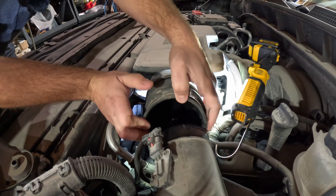You guys can see I made a little bit of a mess down there with the belt dressing, so we're going to clean that up with some Super Clean and get that belt off. You can see the belt is basically shot — there's fraying on it. The belt is not super dry or cracked, but it is kind of shiny and maybe a little harder. You can see the fraying along that edge — that's a good indication the belt has seen better days.